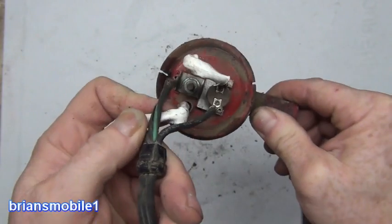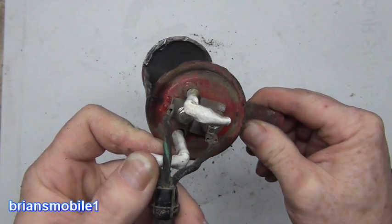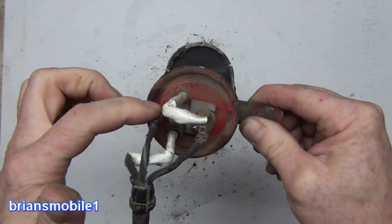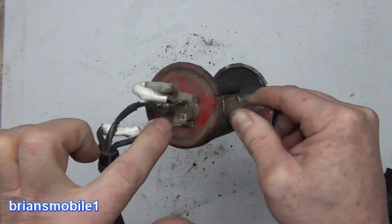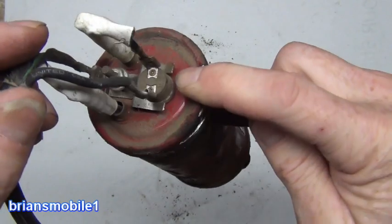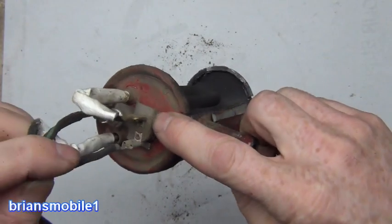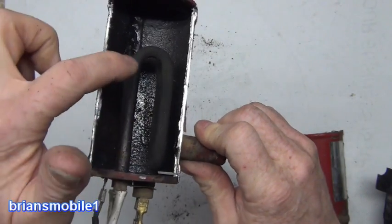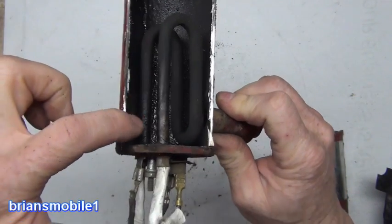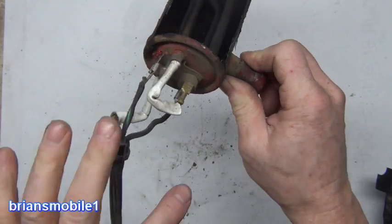You've only got three wires, just like any lamp cord. You've got a ground wire — ground's usually green. You have a white wire that's usually neutral, and then a black wire that's hot. The black wire goes to some kind of thermal switch and then from there goes directly up into the coil, so the power goes back and forth between the neutral and the hot.